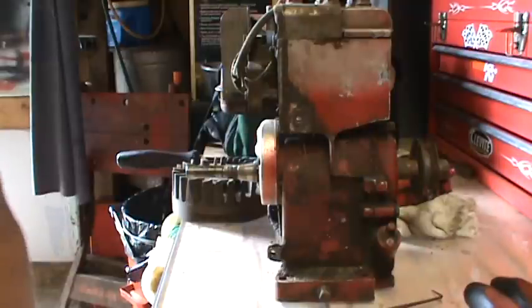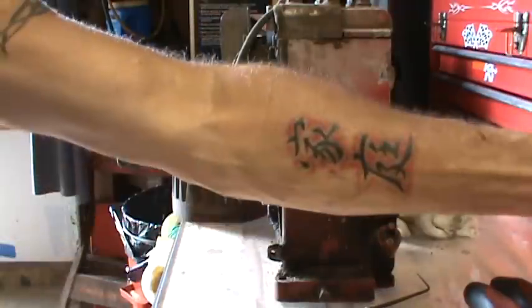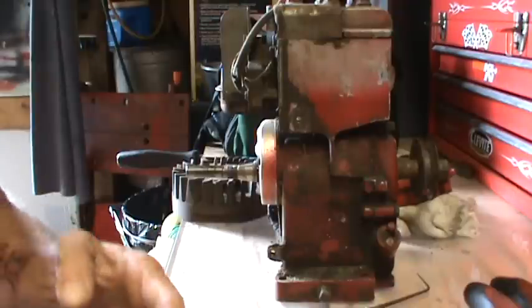The last clean engine that I bought was about 5-6 years ago, and I bought it as a non-running engine. It had been restored. Well, restored was only cosmetic. Needed rings badly. Had no spark. Had to replace the points in it. And it was an old Briggs model WI. It was actually a Sears 500 series, made for Sears by Briggs, but it translated to a Briggs WI. So yeah, you go buy a really clean, nice, pretty engine that somebody has said has been restored. You don't know that until you get that engine running.